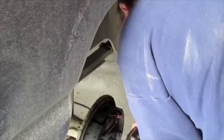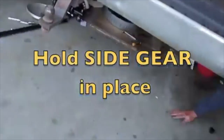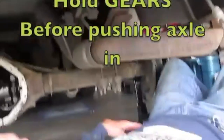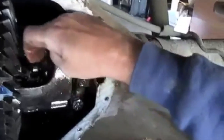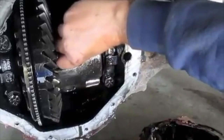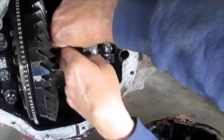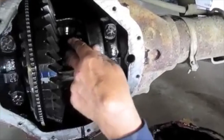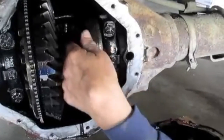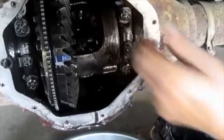There's a tube, so I set it like that and then I go in here. I take my two fingers and hold that side gear so it doesn't flop out of there — there are splines that have to line up. This is the side gear; it's been riding this way with the axle. You've got to move the axle in a little bit. Slide it in there like that — it hides itself in that gear so it keeps it in place.